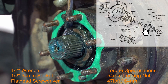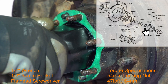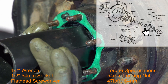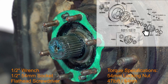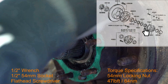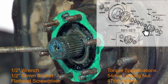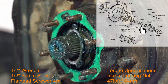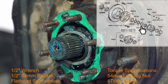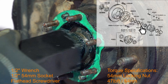Now we have the 54 millimeter locking nut, which sits on top of a star washer. The star washer can be bent to lock the nuts so they don't move and change position. I recommend turning the nut out with a screwdriver rather than your hands, because it's a very messy part — try to stay clean. Then use the screwdriver to pry out the star washer. It's usually bent over to lock both the 54 millimeter locking nut and the 54 millimeter adjustment nut for the wheel bearing.